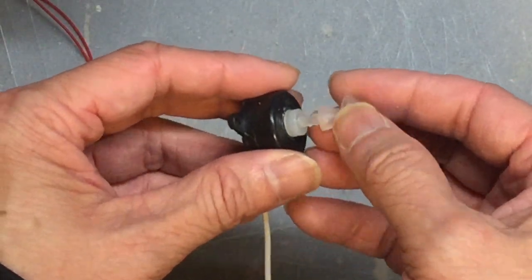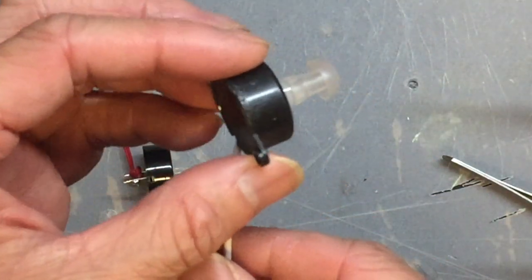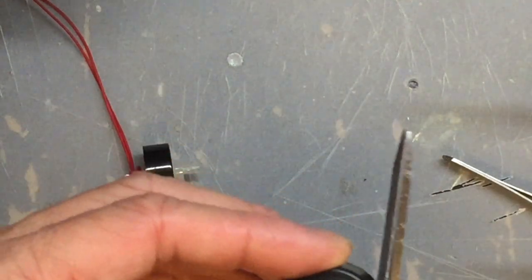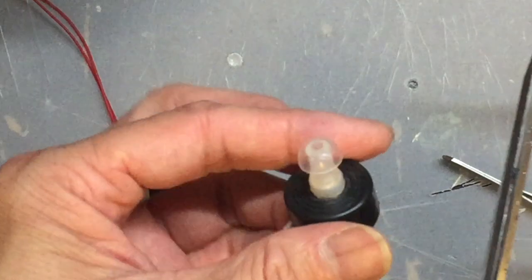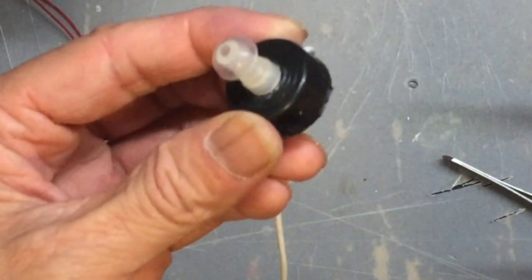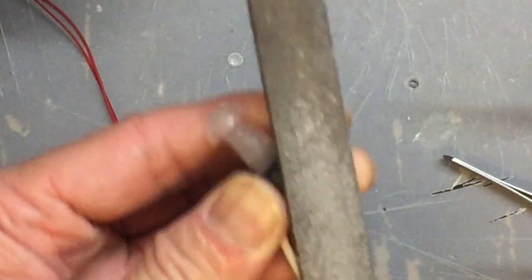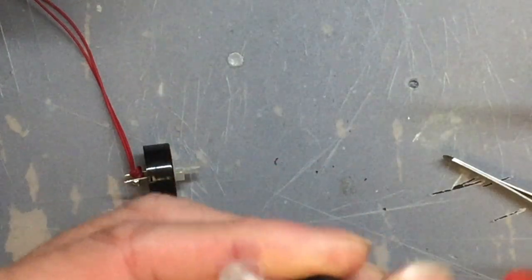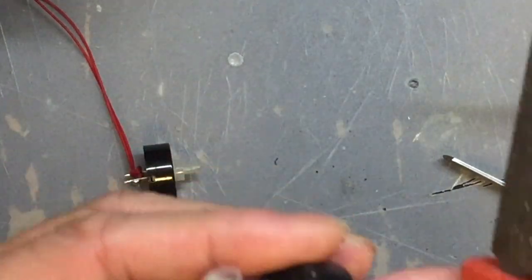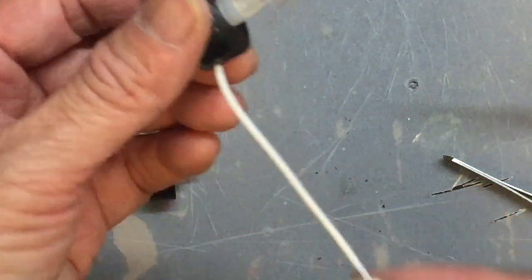Plug in the silicone cushion so it fits nicely in your ear. Finally, smooth out the top edge of the buzzer housing with a file or sandpaper so it will be round. There you have it — your own crystal earphone.